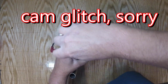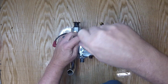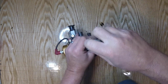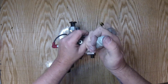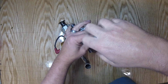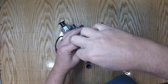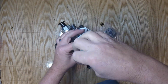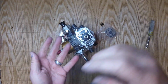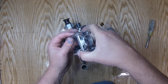So let's take this apart real quick. You have a few parts to these clutches. You've got spacers, you've got the centrifugal shoe, or the machined shoe, and you've got the bearing housing. Well, it's not really a bearing housing, it's a clutch housing, I guess you could say. And you've got the collet, obviously. Now, what's nice about the ones I use, I'll put a link in the description to a couple clutches. You can get them from Dave's Discount Engines, you can get them from Gizmo, at least you used to. So here's the cage.